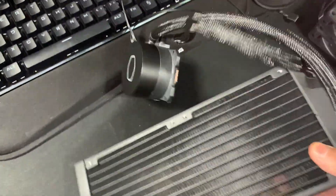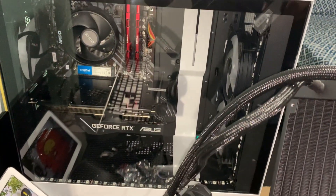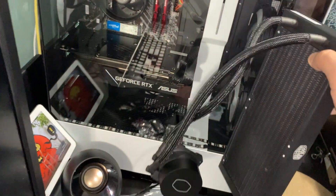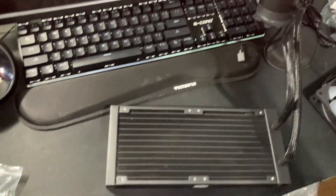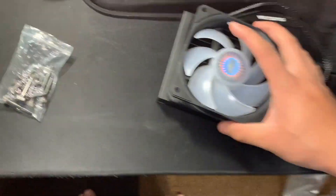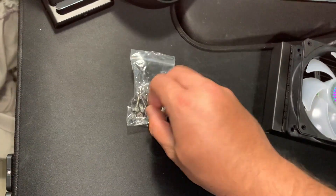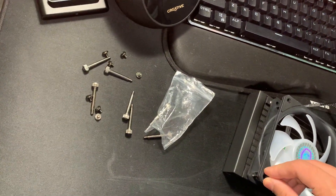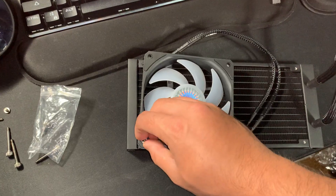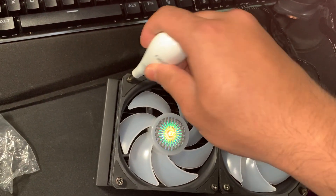Let's figure out the positioning of our radiator. For my case, I only have one fan slot on the top — this is the NZXT H510 — so I'm going to place the radiator at the front. Since I'm placing it like that, I'm going to screw in the fans with the wires facing towards the back. Grab the radiator and one of these fans, line it up, and grab one of the screws. These are kind of like thumbscrews, so you just start screwing them in, then tighten everything with a screwdriver.